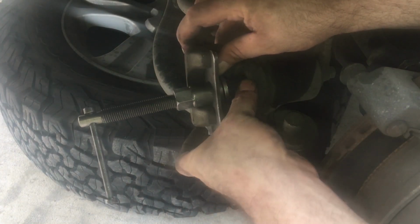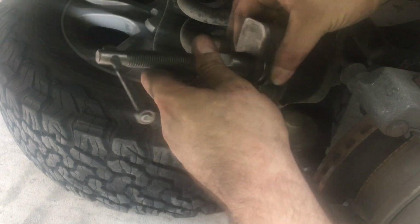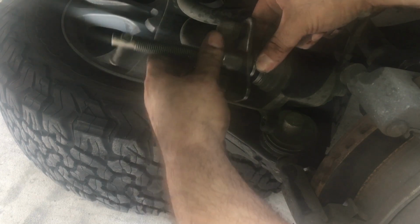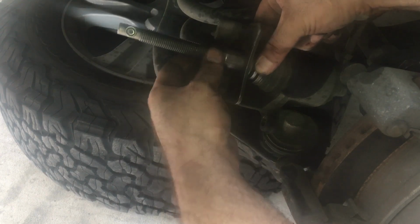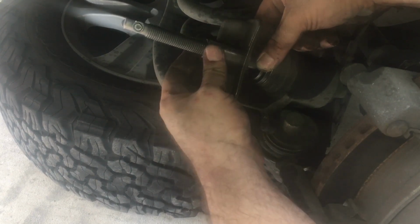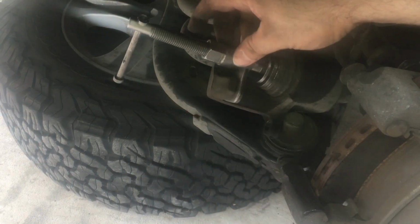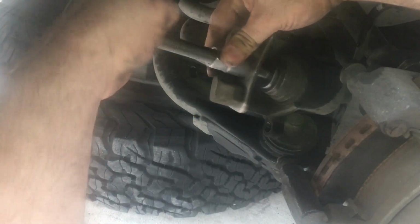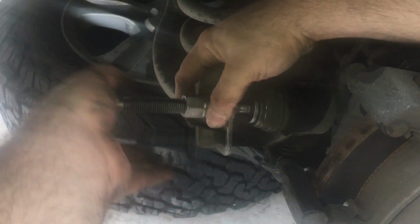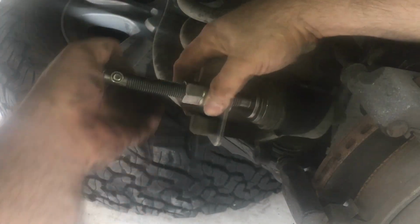So you can, it sits in this groove, so you can go ahead and put it in that groove, and then you seat it. You seat it in that groove. So that sits in there. This is going to go back. So this is going to go counterclockwise. Okay? So when that goes counterclockwise, this goes clockwise. And then you twist. You twist. This goes clockwise. Just like that. And that caliper is going to go in. That's all you need it to do.